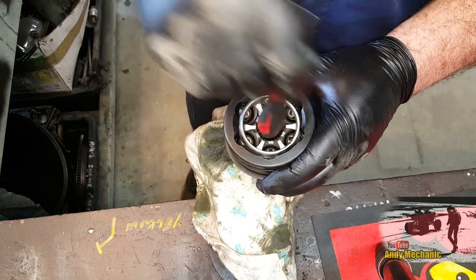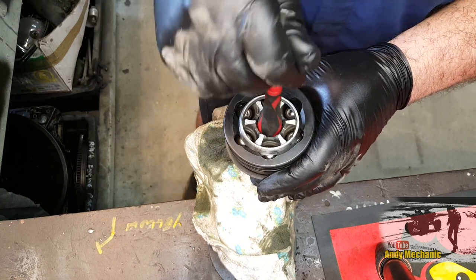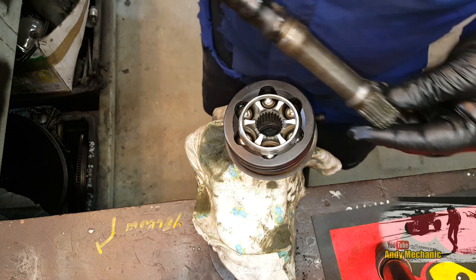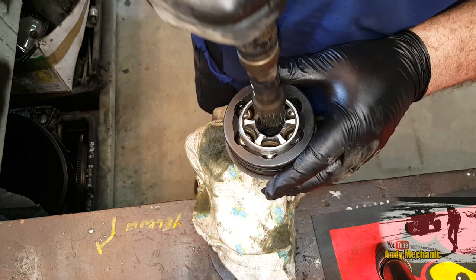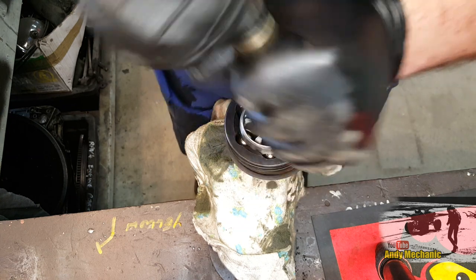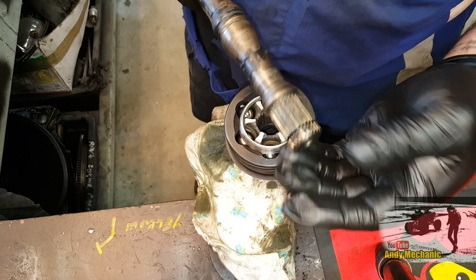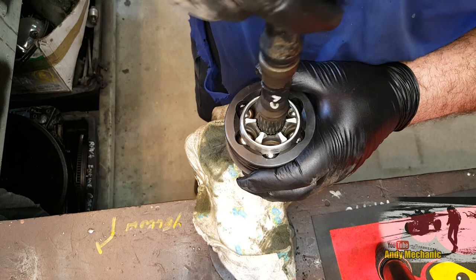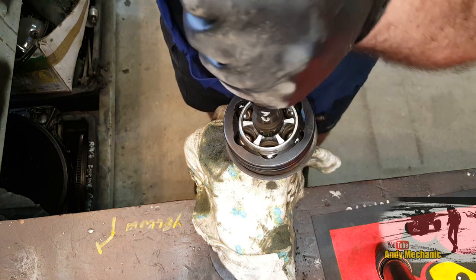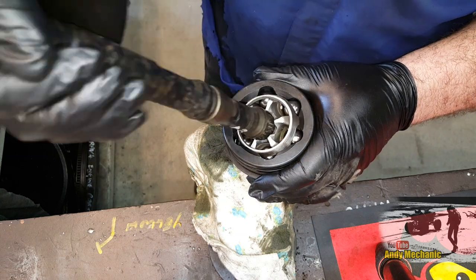There we go — that's the joint, now working without any lubrication in it. You can see how it works. It's actually really cool. But there are a lot of wearing surfaces, and as those surfaces wear you're going to get more clearance, more slack, and the whole thing's going to start to chatter. Wear on these things — you know, you might just feel slack, a bit of clearance between the inner and the actual circlip, so you're going to feel it on the shaft but the joint isn't actually moving. With these, you want to be looking at the joint and it's that in-and-out kind of play. More to the point, it's the rotational play that you're looking for. I'm grabbing the shaft and rotating it forwards and backwards — there really is no movement at all. This is in very good condition.